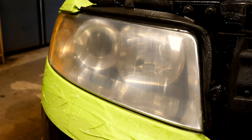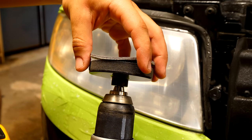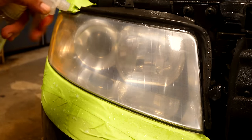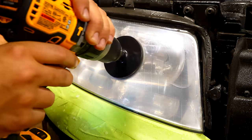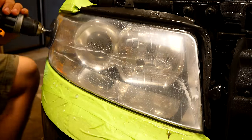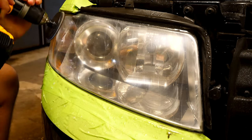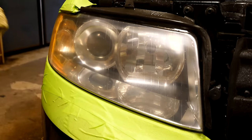We're now going to begin using some proper power tools since it's going to be a lot easier to remove all this stuff. You can continue to do all this by hand, but using power tools is going to be a lot easier. I'm using the same 3M headlight restoration kit from a previous video — a Dewalt drill, a 3000 grit sanding disc, and some water as a lubricant. You're going to do the same overlapping passes with this new sandpaper. At this point you're trying to remove all the scratches induced from the 1500 grit sanding stage. You should be getting some really good results so far, and you will be able to see that the headlights are starting to look a lot more clear at this step. After you wipe off any excess residue, you should have results similar to this — there will still be scratches in the headlight, but not anywhere near as bad as after the 1500 grit sanding step.